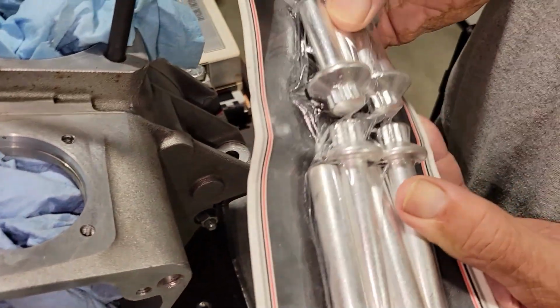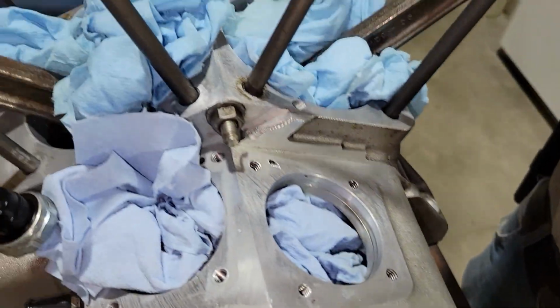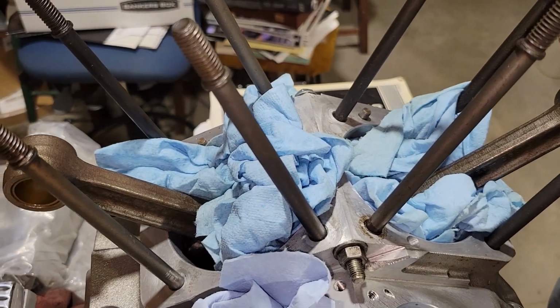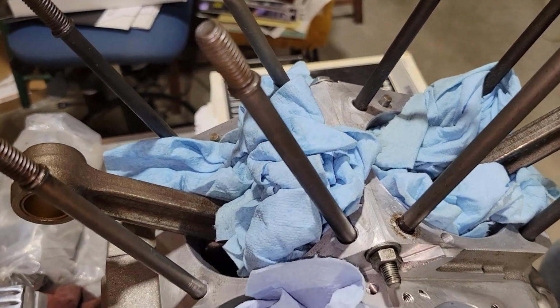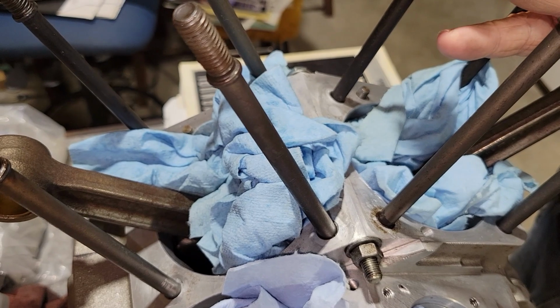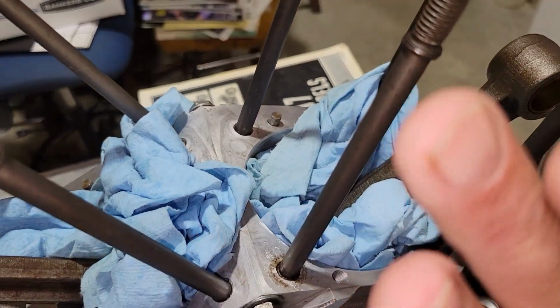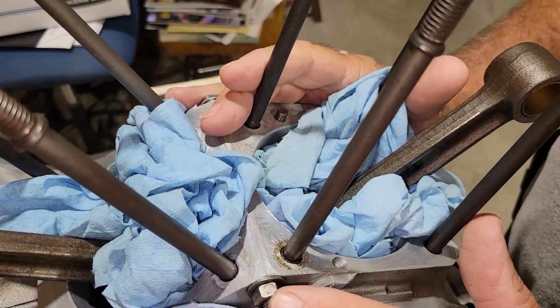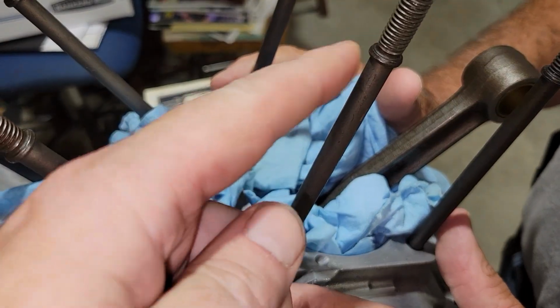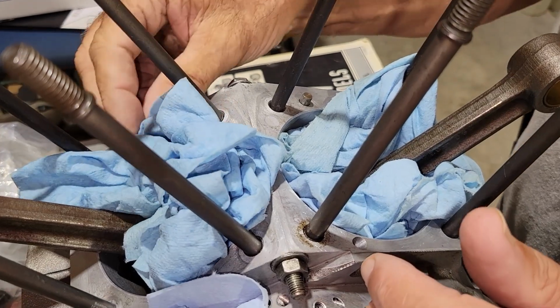When you torque these nuts and head bolts down onto this, if you didn't use a standard Harley head gasket, which by the way is thicker than a James head gasket, quite a bit thinner, the Jameses are thinner, so that brought the head bolt closer to bottoming out. And if it bottomed out before the torque was correct, then the head could be loose, because all your head torquing is up against this. Yep, the head gasket and the base gasket will not be cinched down good enough.